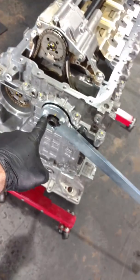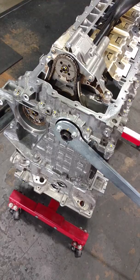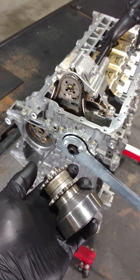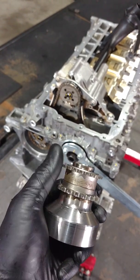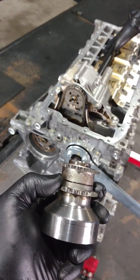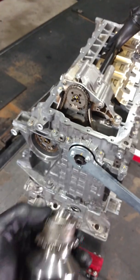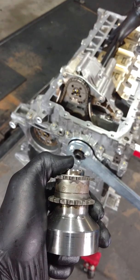They cut the front of the crankshaft off and turn it into a stub, so you can remove it from the front of the engine to service or repair it. The problem is putting it back together again. This hub — you'd think it would be keyed, but it's not. And you'd think these would be splined, but they're not. So what do they do? Essentially they put a little washer — they call it a grip disc — in between each one of these. Depending on the model, they may be a little different. They put all these together and then use that big fat nut, and they essentially pinch everything together and hope it stays tight.